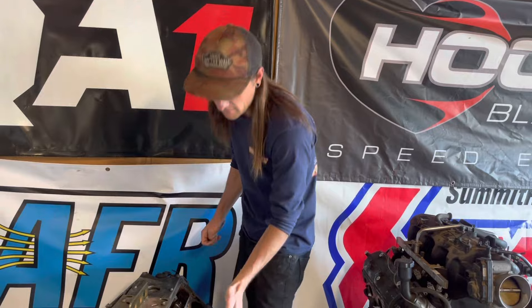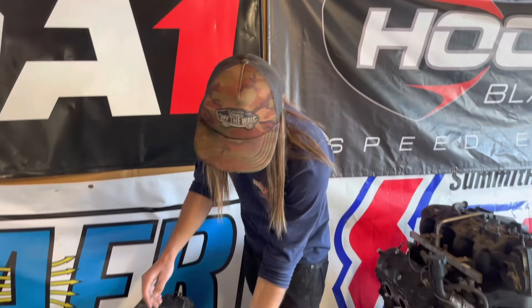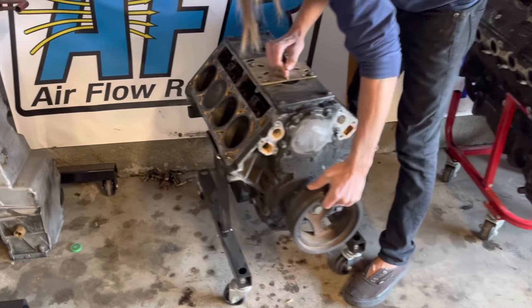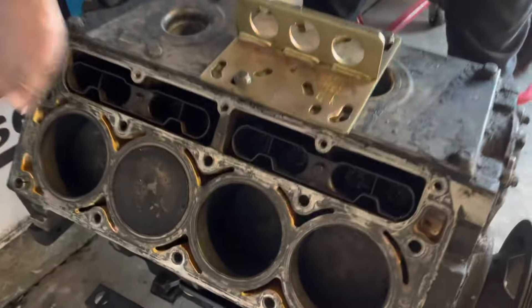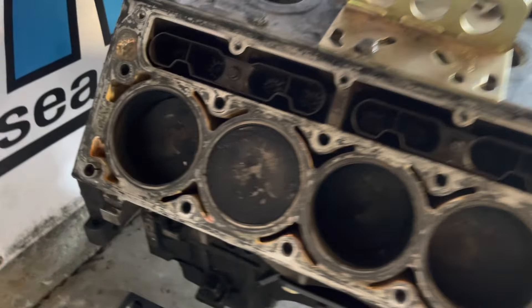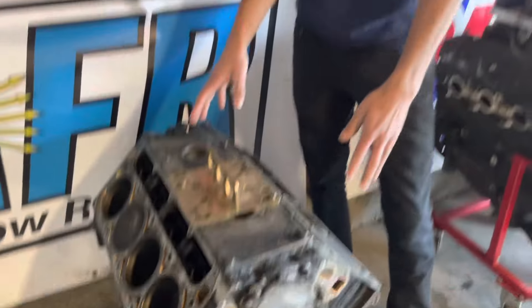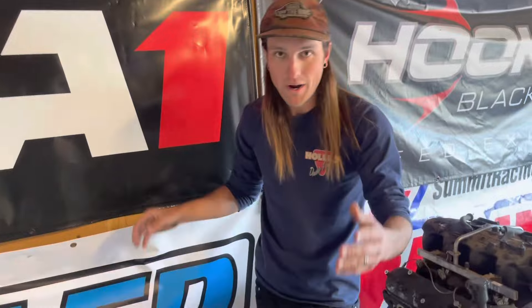It's a 2005, way after 04 and a half. It's got floating wrist pins, flat top pistons, all the good stuff — just potentially a totally destroyed deck surface. And even on this side there are a bunch of scratches because it was literally flipped upside down in the bin.